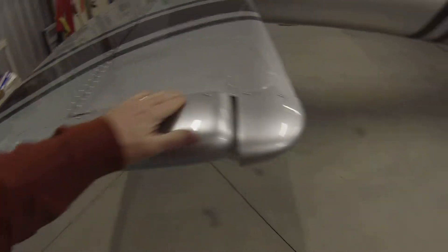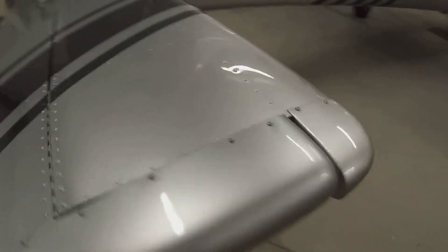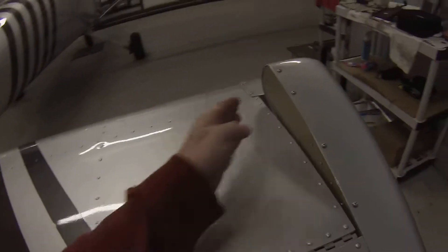Check all the fasteners on this side for the fairings, looking at the inside of the rib — that looks good. Come back around, check the rudder again, make sure everything looks good, then come back up the side of the airplane and move on to the wing.